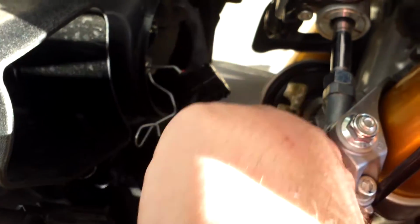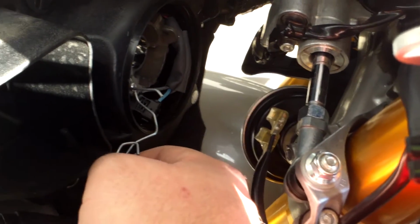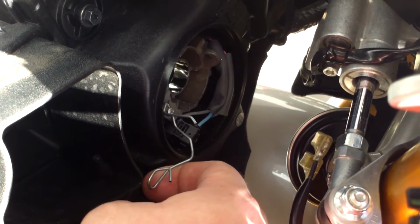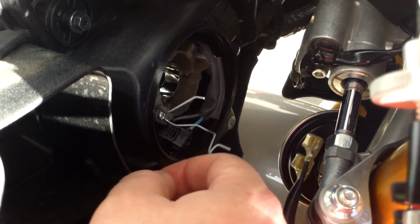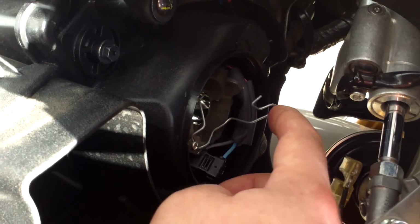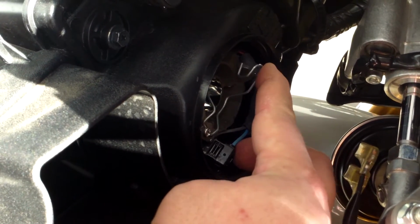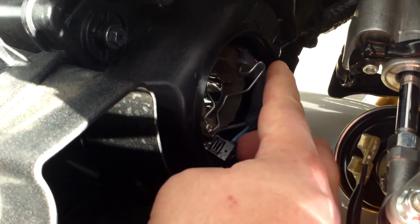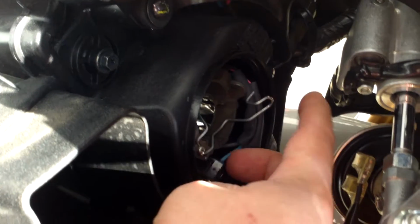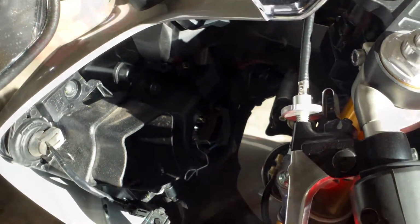And if you're worried about positive or negative, the most important thing to know is that the blue wire is going to be your power wire, and the gray wire is going to be your ground. Finally, the actual mounting mechanism, the spring, did kind of throw me for a loop here. I started grinding on this screw before I realized how this works. The screw point is actually just a pivot. Once you get the bulb in place, you close this mechanism like so, and then there's a hook right here that you lift up and hook into place, and that's it. To take it off, you push in, lift up, and then pull back. It's pretty much the same thing on the other side.